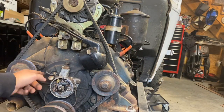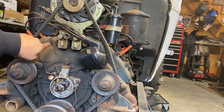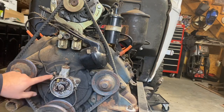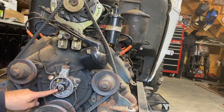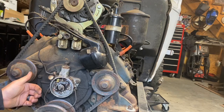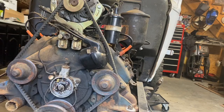This small circle is our condenser. The ground wire from the coil goes into the condenser, and the condenser goes into the points. The condenser keeps the points from burning up and is what grounds the points. My rule is: if it needs points, it needs a condenser; if it needs a condenser, it needs points. Condensers are extremely cheap and points aren't expensive either, so if you want a reliable motor, replace them both at the same time. I highly recommend it.